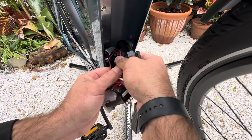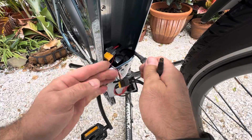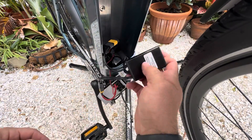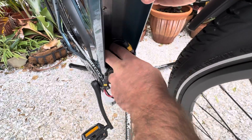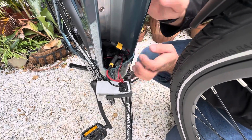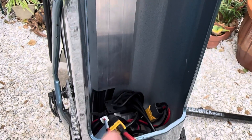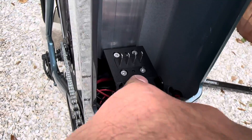I'm going to plug that in to the battery side input on my balancer. Then I'm going to unplug my plate and plug the other one in to the other side of the balancer, and then plug the output of the balancer into the connector that's attached to the controller. Then I'm going to take my slack out of my existing cable and fit my balancer inside here. The controller is oriented this way — I kept the orientation. The balancer sits crossways in the back, which is the back side of the battery insert in the bike, and the wiring gets pushed to the side. It will sit in the housing just like that.